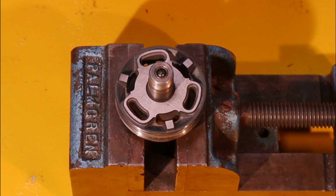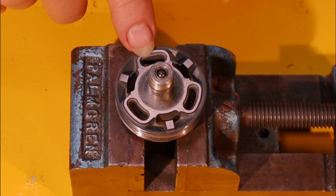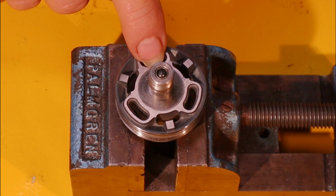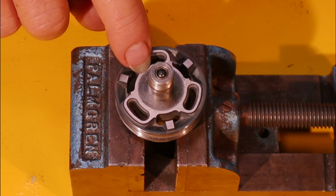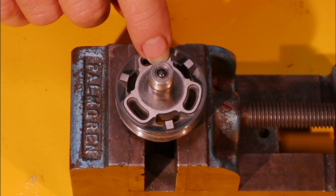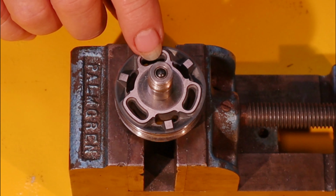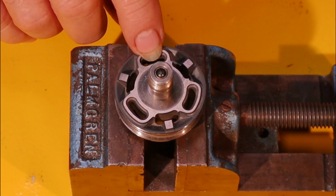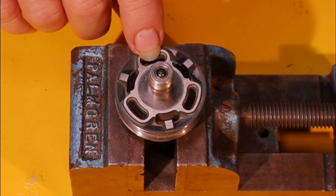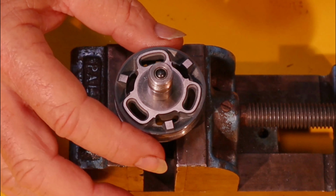So if you want to use a clamping shim, you have to make sure this clamping shim isn't going into the port, leaving a little room, because this clamping shim is on top, but the sealing shim is bending from the edge of this. So you always want it bending over some metal, so you want to leave a little space here. You don't want it protruding into the port because it fatigues the shim, number one, and number two, the shim does not bend inside the port. It's bending out here, and you're not using all the port. The port's restricted.